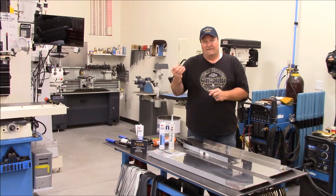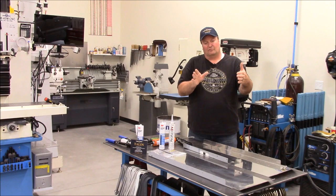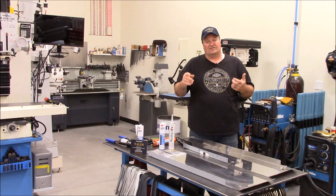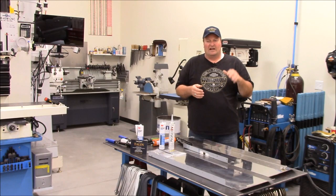Flat floor uses a glide bar, and the slide literally goes out and drops down flat. Easy way to remember: flat floor goes out and goes down flat. The raised floor is above the floor grade. That's usually your galleys, couches, and so forth that slide in and out, and those ride on rollers.